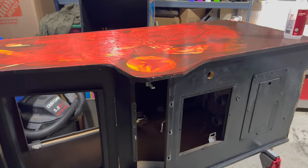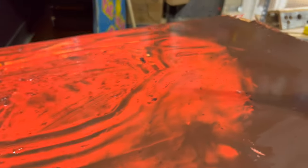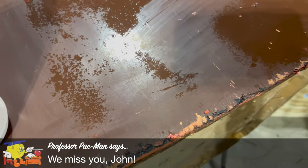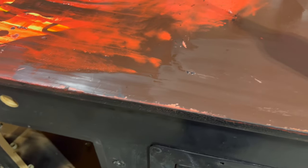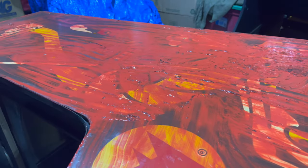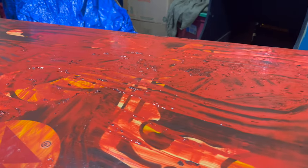We're down to the brown paint — this is the original brown paint from the Joust cabinet, and this is what we want to see. What I'm doing now is just coming back with a spray bottle of 91% isopropyl and cleaning up this loose stuff. It's slow going so I'm just going to keep at it and then come back in a moment, and hopefully you'll see a nice clean side of Joust stenciled artwork.